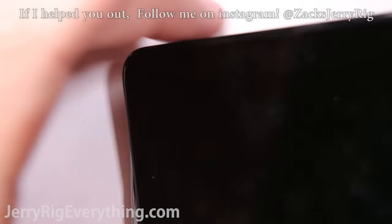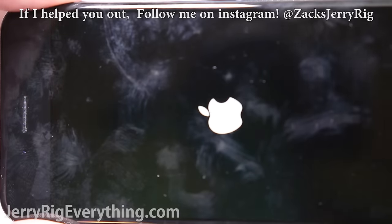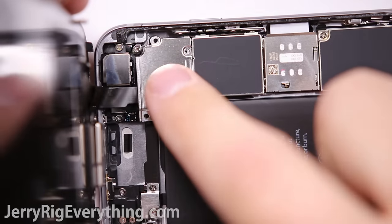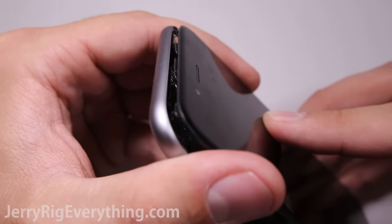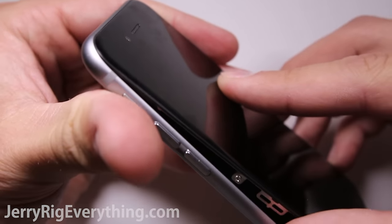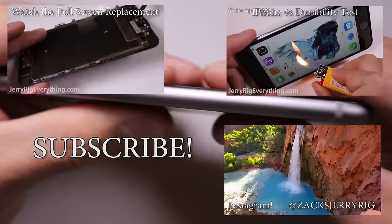Before putting the metal plate down, test to see if the screen is working. If you have lines or a white screen, there's a good chance one of your connections isn't quite right — disconnect and re-plug the ribbon cable. Then to line up the screen, push it into the top of the housing first, and slide your hands down the sides to lock it into place. Get the two screws in at the bottom and you are good to go.